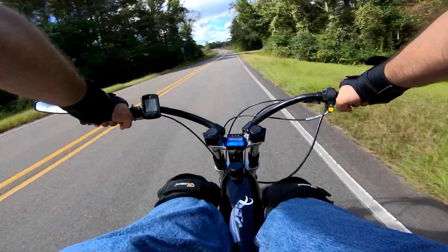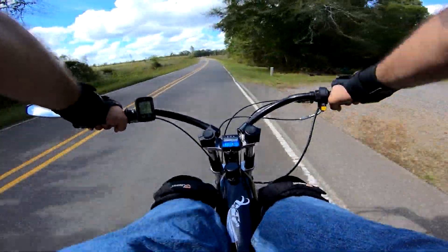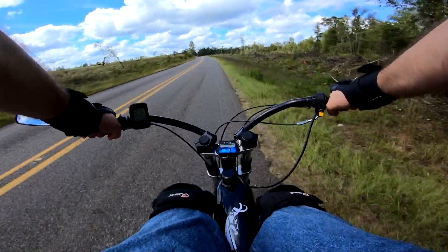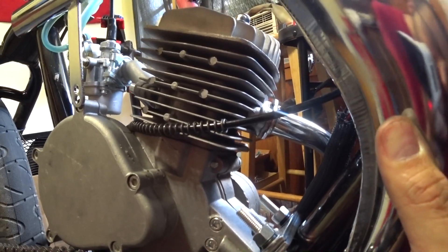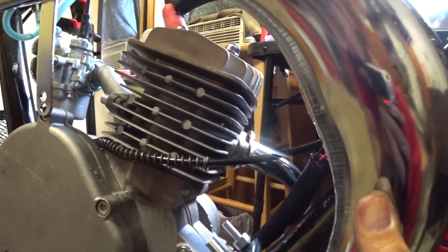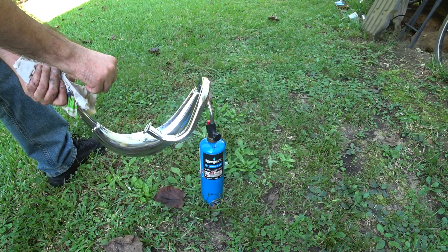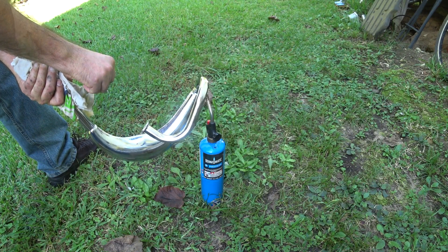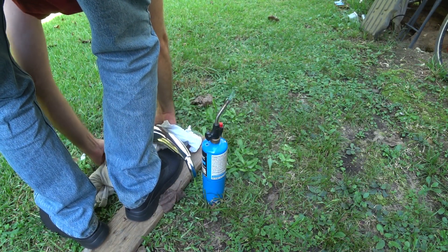As I still have a lot to learn, but mark my words, I will learn it. And so will you. For now I'm left wondering if this pipe is actually doing what it's intended to do, or if the design is too poor and it's simply providing a less restrictive exhaust, which is where we're getting our performance from. The pipe is designed to reflect pressure waves, improving efficiency and performance, but I don't really know if it's doing that. There are a lot of calculations that go into designing these pipes to get them to actually do what they're intended to do. For now this is what we have, so we'll push on. And it is an improvement, so we can take that for what it's worth.